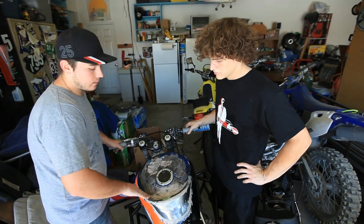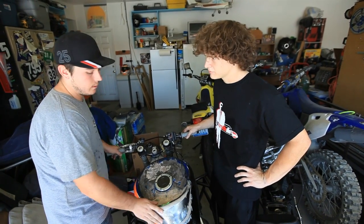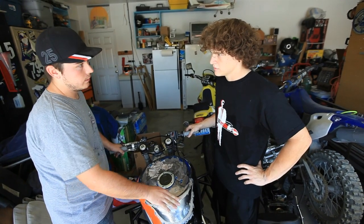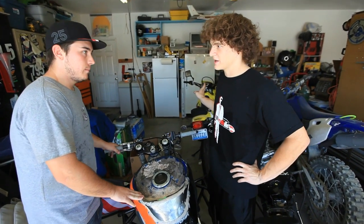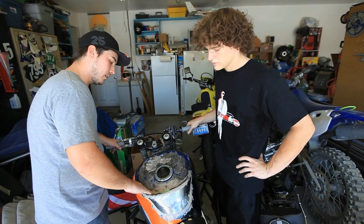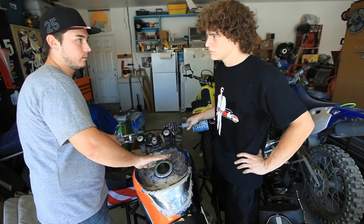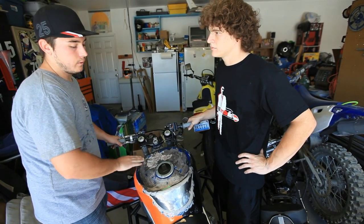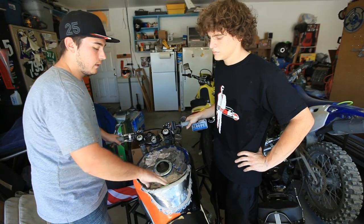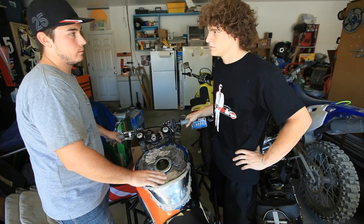When I got the tank, I dented it out really nice and wide. And then I built this kind of a massive lip with a nice round edge on it. I mean, it still hurts, but nowhere near like that sharp point. I've seen a lot of people with dents like that and it always looks pretty painful. But the most important thing is that it's a nice fishbowl shape. It's not a real steep, aggressive lip that you just kind of pop over. It's like a shelf you sit on, and you can sit anywhere in here and have good control over the bike. You can maneuver, roll back and forth, and it holds you in.